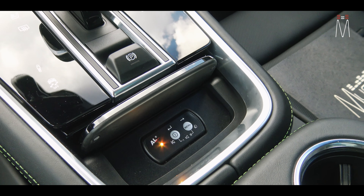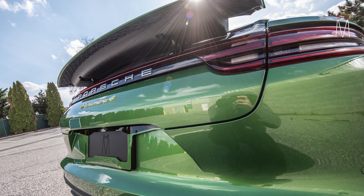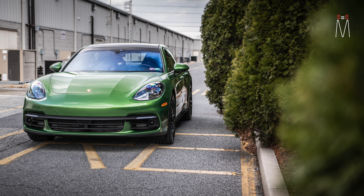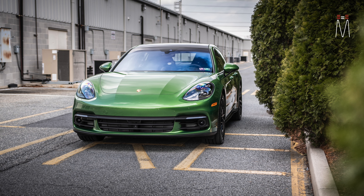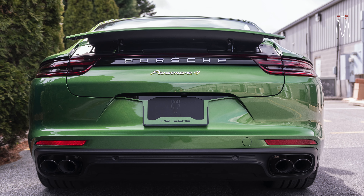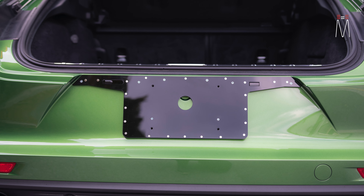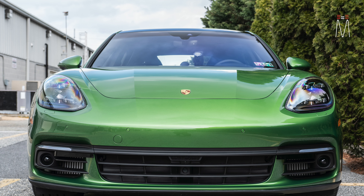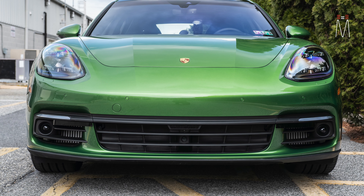We're also running Net Radar DSP for front and rear. You've seen some of the videos where we use the Escort Max CI radar platform, which has a physical display to tell you information — this does not have that, so there's actually less stuff to install, which makes it more convenient. It is still a DSP head, so you can narrow the bands, eliminate certain frequencies — you have a lot more control over the radar heads. They are also updatable.